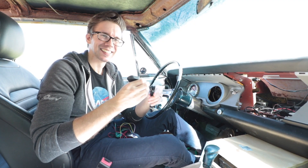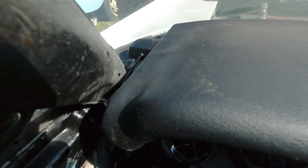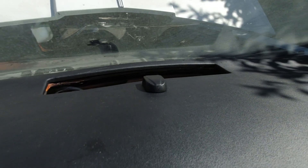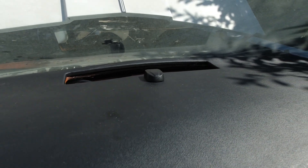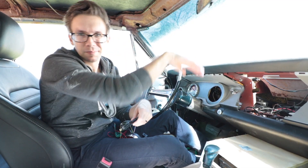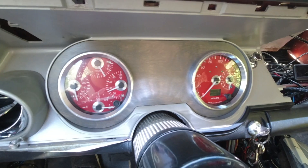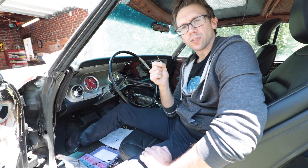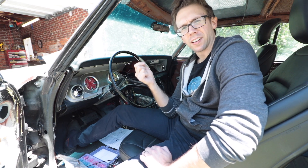That's cute. My way of installing it is to just throw it on the dash. My tip though: if you've got a dash with a defroster vent, run it through the defroster so it pops out and you don't see the wire, or just run it to the back edge and don't look at it. I wish Speed Hut would invest a little more here — like Dakota Digital — and make it so you don't have to use pull-up resistors for their tachs on some of the newer stuff. It doesn't make any sense. It's 2020-something.